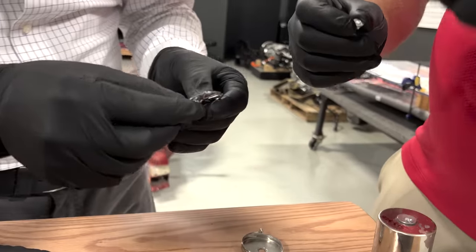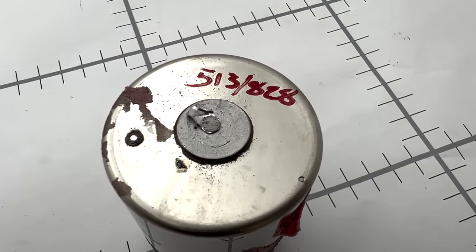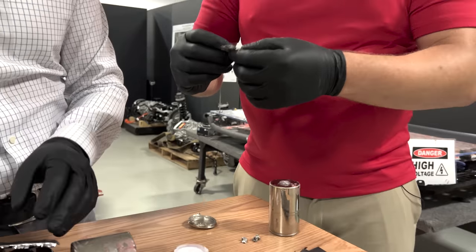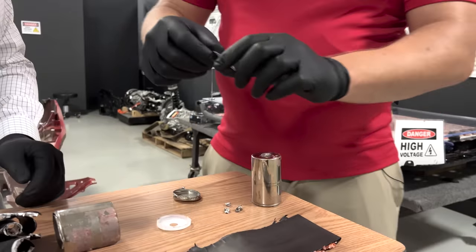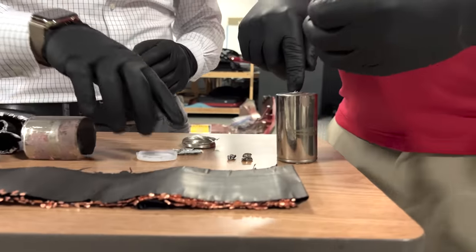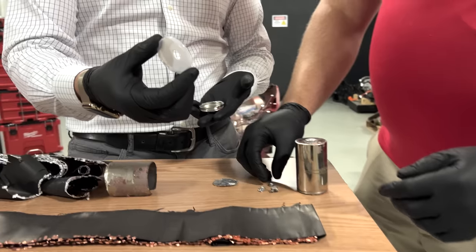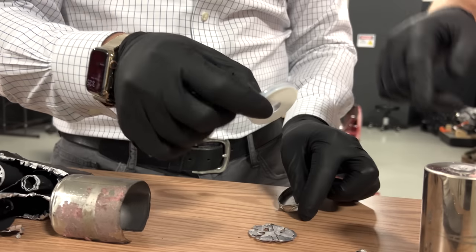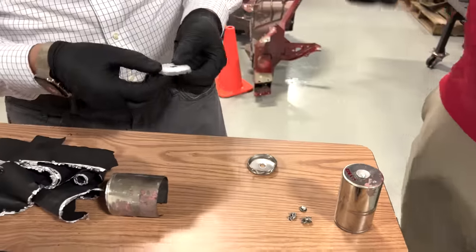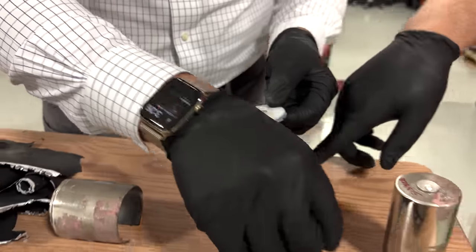What's in the center right here? The reason we don't have that outside ring — which was attached to the crimping — is we have a small rivet that attaches to the top positive terminal. That was either welded or stamped into place; we're thinking it might be a stamped process. So the process would be: these pieces are welded onto either end of the jelly roll, and then this is either welded or stamped into the positive terminal. This right here is essentially an insulator — you want to avoid having this touch the can, because if it touches the can it would short out, since the can is negative. So that's an isolator: you need to keep anything from short-circuiting within the anode to the cell or cathode to the cell.